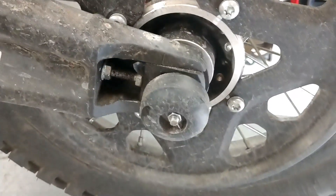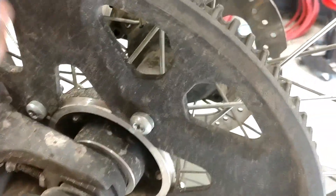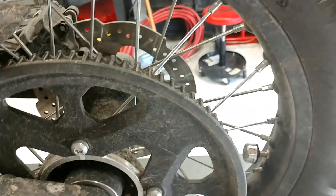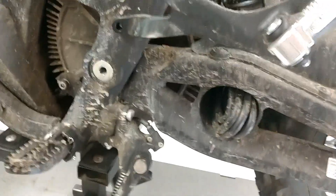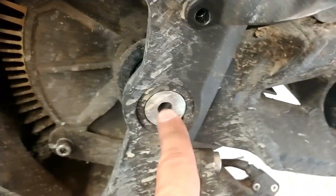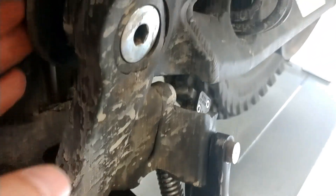I do have to pull the rear wheel off. These aren't obviously factory — they're just skateboard wheels and some all-thread to give me an axle slider, so I've got to pull those off. Otherwise it's just four bolts to change the rear pulley to the rear sprocket. Once we get the swing arm out, you can see the motor is concentric with the actual swing arm pivot. There's no clearance back behind there, so to get the pulley off, that's one of the reasons the swing arm has to come off — we need this clearance to actually pop that part off.